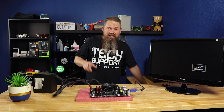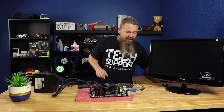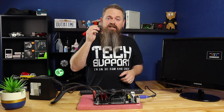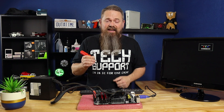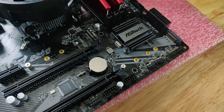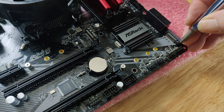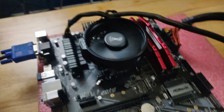It's a really good idea to have a keyboard and mouse ready when you do this. I'm going to use a wireless keyboard and mouse and plug the wireless dongle into the system. As soon as we plug power in, we should be ready to go. To fire the system up, take a screwdriver and use it to bridge the power button on the motherboard. Be careful not to short out the wrong thing — be cautious what you're touching hard metal objects to. On this motherboard, the front panel header is right here, and it's the pin on the outside right that gives me power. Just arc the screwdriver on that pin to complete the circuit, and as you can see, the system fired up.